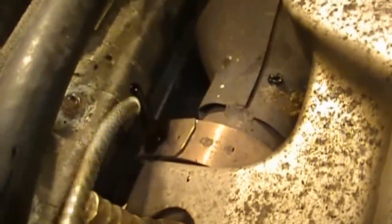Got the cams off - they're pretty straightforward. Those are little 10mm bolts across. Put them in a box with a little hole knocked in it so they can't go anywhere - that way if I bump it and shake it, they're in line. I've got my little mark showing me it's the front of the engine. Now I'm going to take the head bolts off. Buy one of these oil cans - I use all my used oil. You can lubricate a lot of stuff, especially bolts when you let the oil set. It's a great way to use your used motor oil.